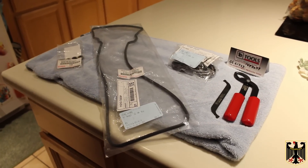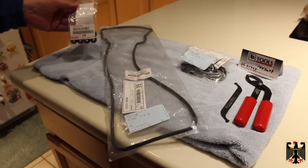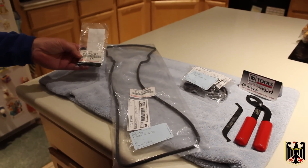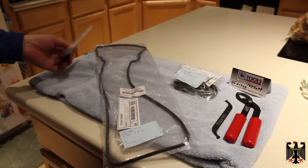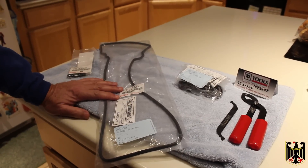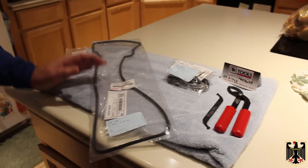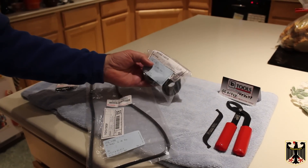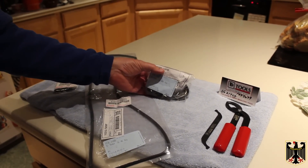To do that we're proactively going to go ahead and get some parts. On our particular valve cover there are 10 washer seals, part number 90210-07001, and our gasket is 11213-75030. For each spark plug hole there's one of these particular gaskets, part number 11193-15010.